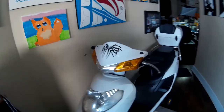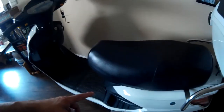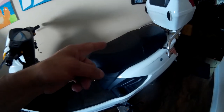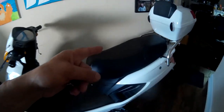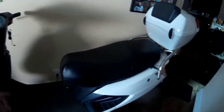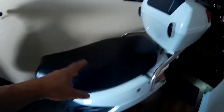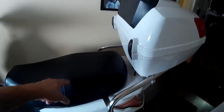Today my throttle died after I had upgraded the controller to an 800 watt, 80 volt controller that I've overvolted. You can see the wire coming up there. I put an extra 10 to 18 volts into the pack. I got it running so the rest of the bike only sees the original voltage — the only thing that sees the extra voltage is the controller.